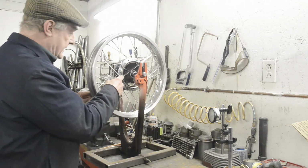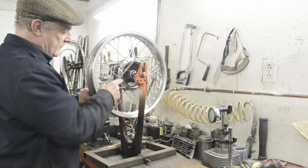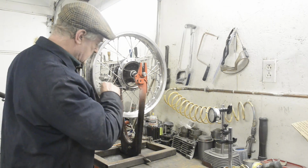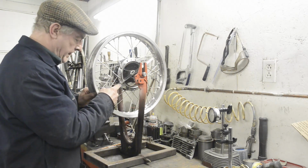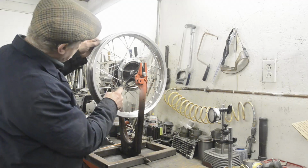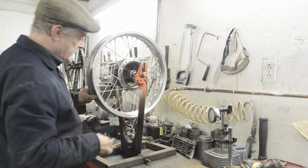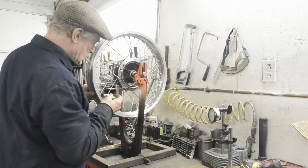So let's try point number 3. Point number 3 is fractionally this way. So at this point, because we don't have any tension in these spokes, we can just tighten them up just a little. A couple of spokes at the point where you're measuring. And that's about right at number 3. Oh, number 4, we're a good 1/8 of an inch to come this way. So this time we're going to tighten a couple of spokes on this side so that we're pulling them over here.